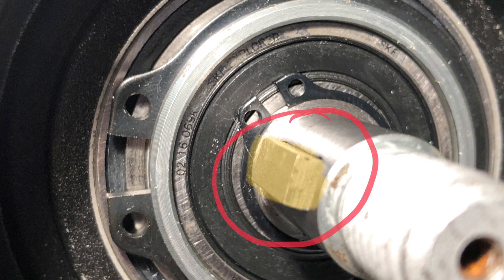On the shaft, you'll notice a shaft key. Set it aside and put it in a safe place. If the key isn't in the shaft, it probably fell out when you pulled the flywheel off. Before moving on, make sure you locate it.